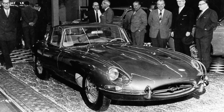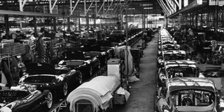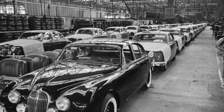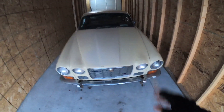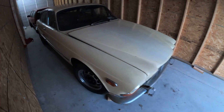This is the car that was known as 'saving Jaguar.' What happened was in the '60s when they originally designed the E-Type, it looked amazing — everybody wanted one, they couldn't build them fast enough. Their two-doors were really constrained by production, but their sedans were hopelessly out of date, pretty much from the '50s. They needed something new, more like the E-Type — that's where this car came into play. The engine, trans, and rear end are all from an E-Type. All the ones that came to America had automatics, so any manual transmission ones have been swapped. This is apparently a Jag transmission, possibly from an E-Type or a Mark 10.